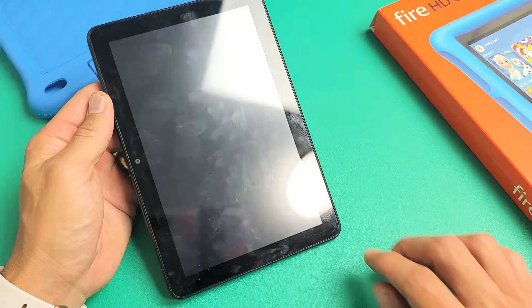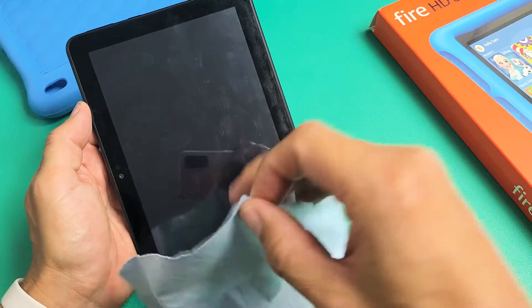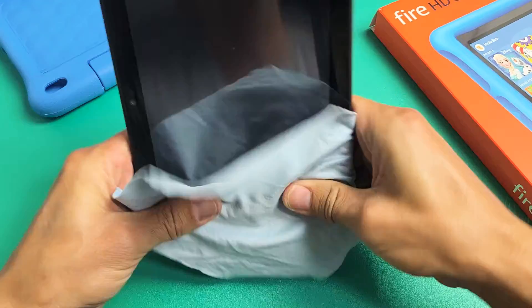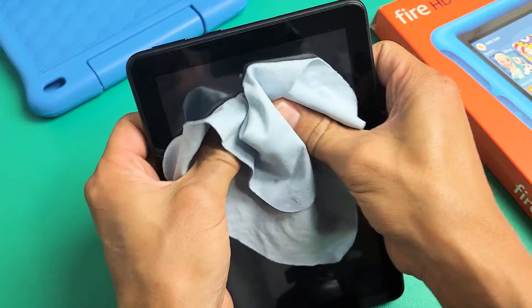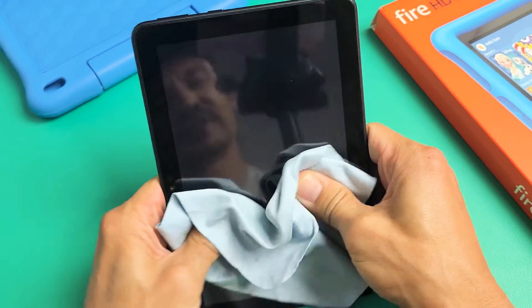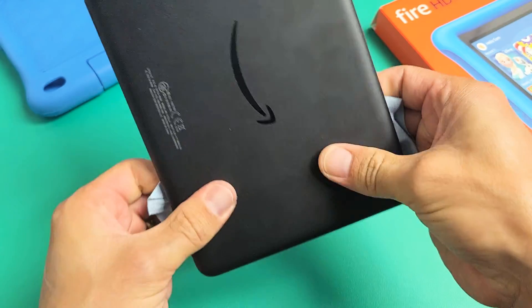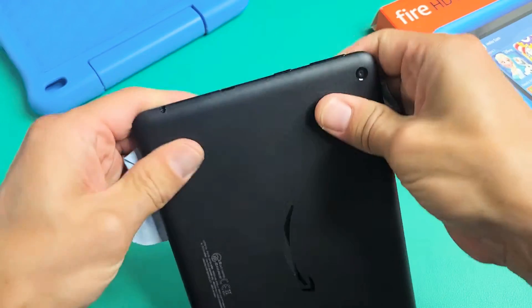The fourth solution — I call this the massage method. We're going to massage the tablet. Same premise as the previous tap: you basically have something that's slightly dislodged, and even a massage can pop it back into place. Hold the tablet and press in with your thumb all over. If you don't want to get the screen smudgy, you can use a cloth or towel. Press in all over — sometimes you hear a click and all of a sudden the screen will pop on. Sometimes half of it may come on, or it may turn on and off right away, or you may get white lines. Or sometimes it'll just turn on and stay on and you're good to go. Keep massaging everywhere, even on the sides, and the same thing on the back.